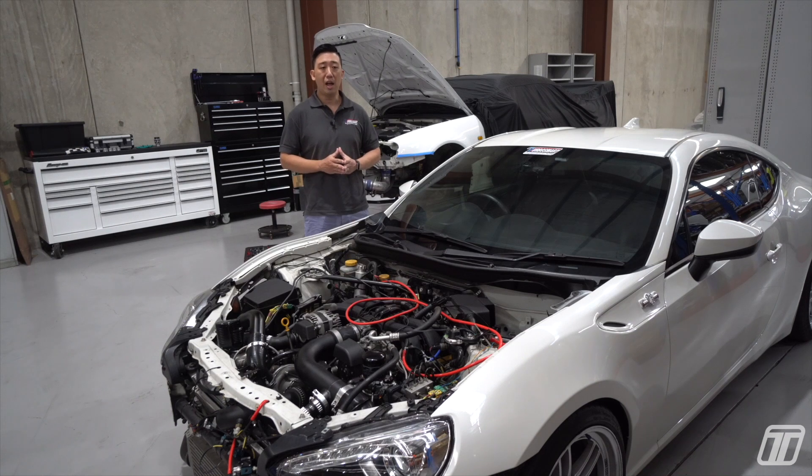After a bit of fault analysis we realized that the oil pressure out of this engine is actually extremely high, and it varies from cold start to being warm. After reading the instruction manual of the turbocharger we found that the oil pressure had to be a lot lower than what the engine was producing. So we investigated: how does the market currently control oil pressure to the turbocharger? We found that the most common method was using small inlet restrictors in the lines.